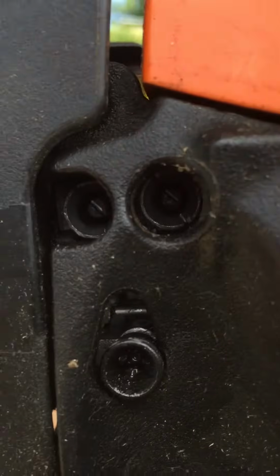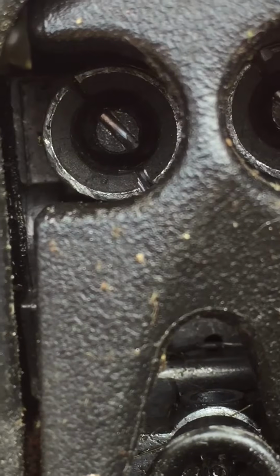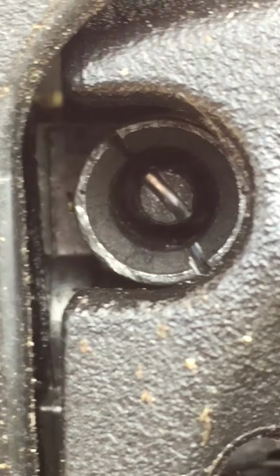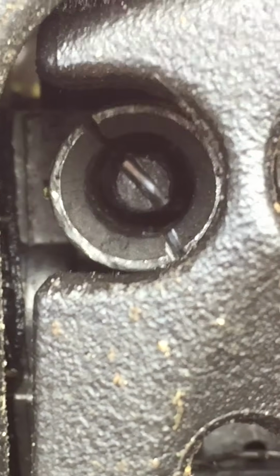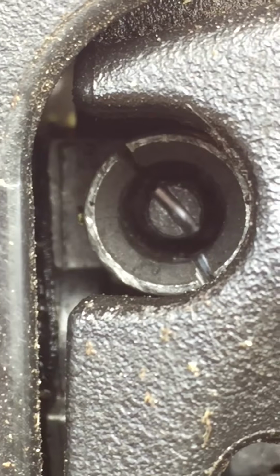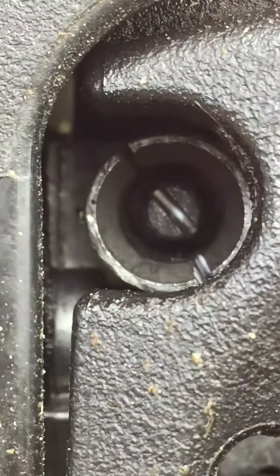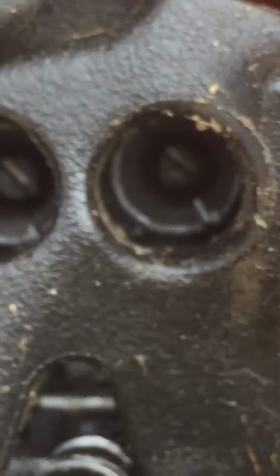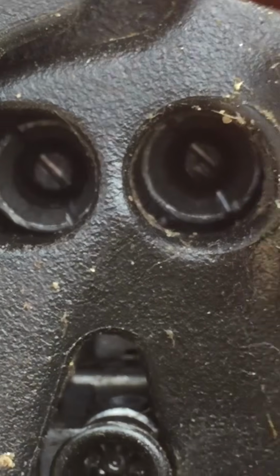And I tried, I don't know if you can see in here, I tried all sorts of things inside. The mixture screws are little M3 hex nuts with tiny clearance around them. So what I did, I got a little cutting disc on one of those little rotary tools, little electric die grinder type tools, and cut a slot right through the aluminium housing, both sides, and then cut through the screw, so I could actually screw out the mixture screw with a little flat-headed screwdriver, and that wasn't the problem.